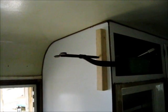I've got the insulation in, I've got the wall up, sort of. That glue is not going to dry very fast, so I'm using a massive C-clamp, and I might try to gently put two more inside the fridge. What I did is I put it inside the cupboard with a piece of wood inside and a piece of wood outside. Careful not to touch my paint, I hope. Oh yeah, a little bit. Anyway, I'm going to probably put three of them, one here and one here, and that should hopefully help brace this wall up until the glue sets, which it actually never really will from my experience here on the tiles, but it'll become very, very tacky, which should be enough to hold that lightweight wall up.